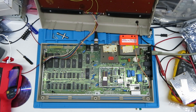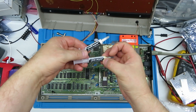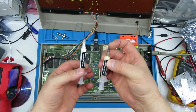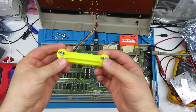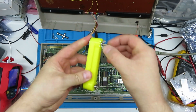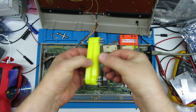It's not thermal compound I'm going to be using — it's actual two-part thermal epoxy, which is thermal adhesive, not the same as thermal compound. I also 3D-printed some clamps — nothing funky, just an M3 bolt, a couple of washers, and two pieces. The legs sit either side of the chip and put some pressure on while the epoxy is going off, and trust me it does not take long to go off with this stuff.